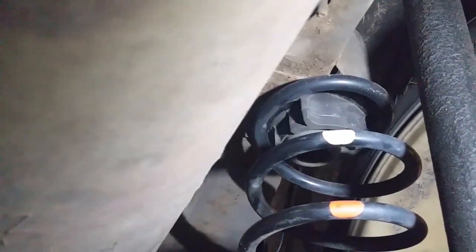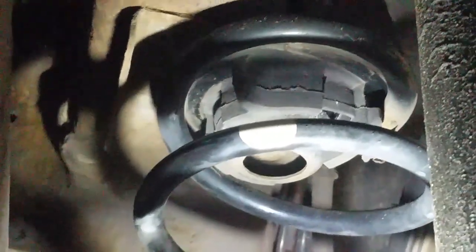There's not an awful lot holding that spring in at the minute. I'm getting a bit of light on that side of it. There's the break there, and it's just that last wee bit - that last wee sort of corner - that's holding that spring in place. That spring is trying to make a bid for freedom. You can see that it's not seated at all, and when I give it a bit of a wiggle I'll be able to pop it out.